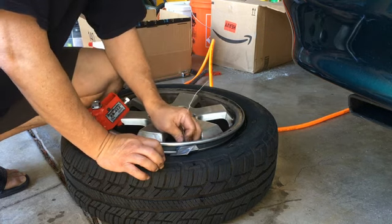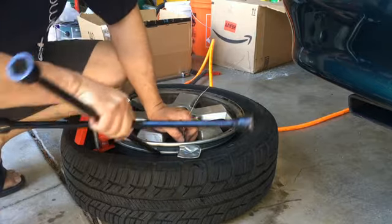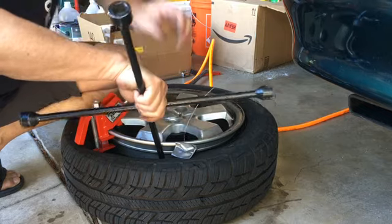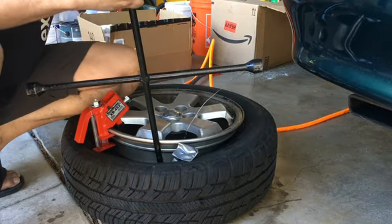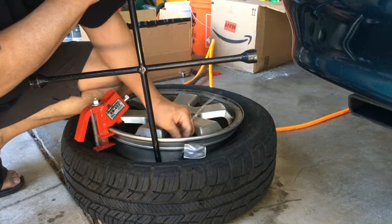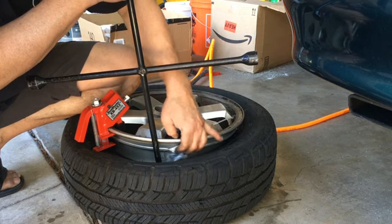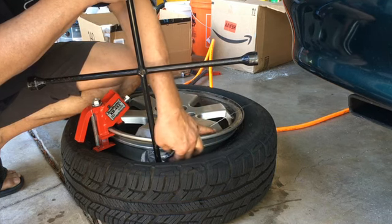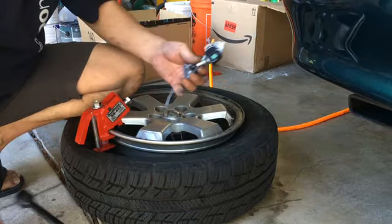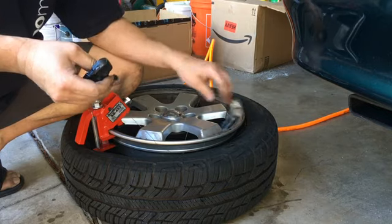There's a washer in there. So now I can just drop this tire pressure monitoring system. I need space so I grab the tire and bring it out. Hopefully I have too much electrical tape here — you see it drop. And with the duct tape, I can fish it out. Easy peasy.